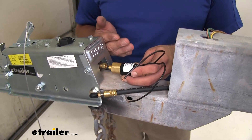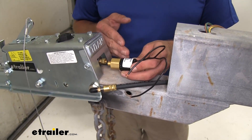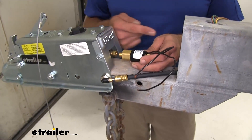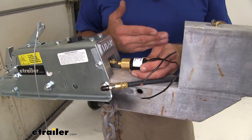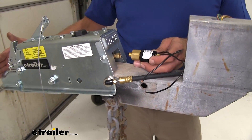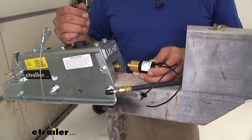This is important when you're backing up a hill and you want to have your trailer wheels turn freely. It prevents that pressure from being sent back. Otherwise, when you start to back up a hill, as the actuator gets compressed, it's going to apply the brakes and make it difficult to back up.